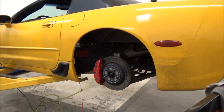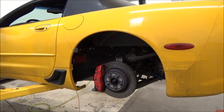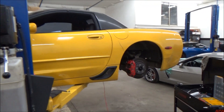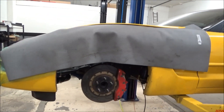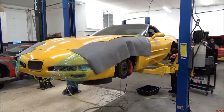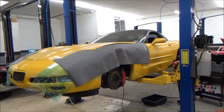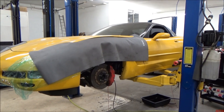Just mounted the pump and fuel regulator. Went over to wiring on the boost pump on the factory pump that's in the car. Got our lines, almost tapped into the fuel tank. We'll wrap this up, get it on the dyno. We're fixing some couplers on it and fixing a few other issues the car has. We'll see where we end up with the D1 on it. He bought the car as it was - apparently it's got a built motor in it. I think it was around 680 before with the P1 SC.